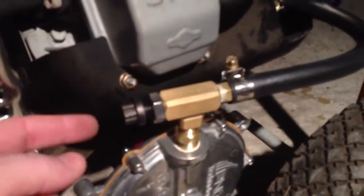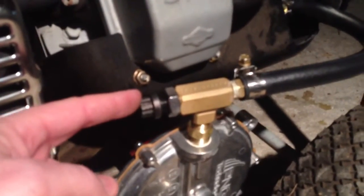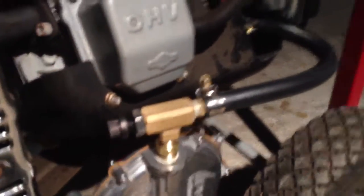There's a little regulator here that you need to watch once you get your generator hooked up — you've got to tune this. This kind of gives you your amount of fuel that's going to be going into the carb. You don't even have to drill your carb out or anything else. You just put this aluminum piece in between the air cleaner and where the carb usually sits, feeding the propane right in between the air cleaner and right before the main carb.